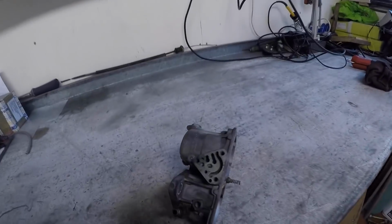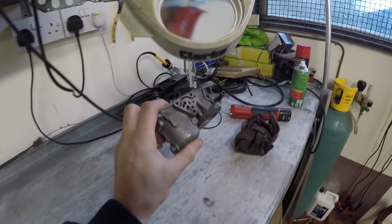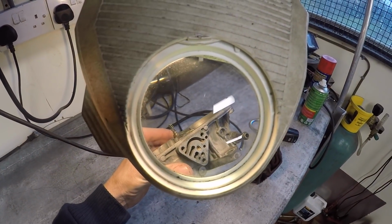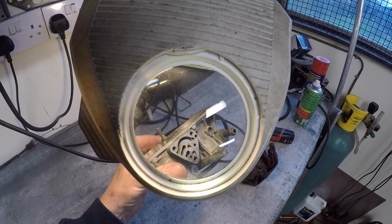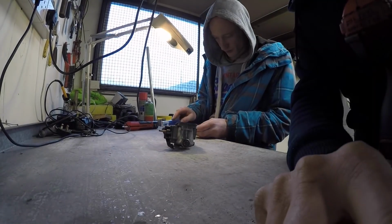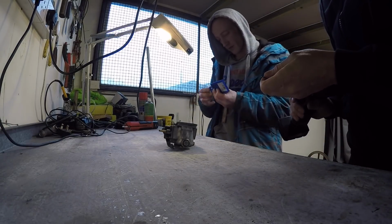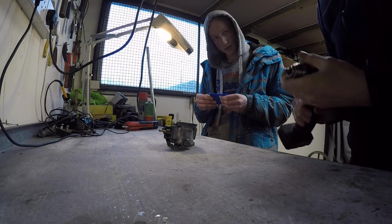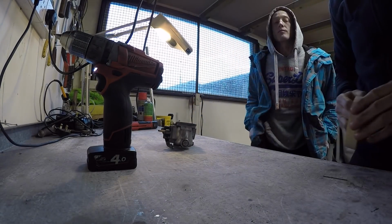So, get a drill bit for this, they're at a bit of an angle. See it there? Probably see better through here actually. Just turn this on. I don't know whether that's going to focus, but if you see it, it's at a funny angle and sort of recessed, so the bit you've got to drill out is deeper inside. So we're going to get some drill bits and sort it out. Is that 1.3? That's 1.3, defo. See if this chuck holds it. No, it doesn't. I have to do the masking tape trick, or get the Dremel out. I think this will be alright.